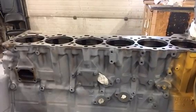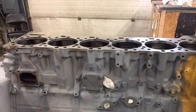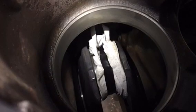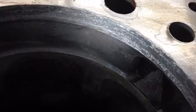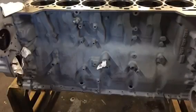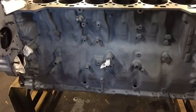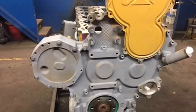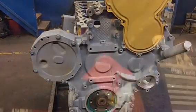This block has the crank in it with the front and rear structure on it. Got it back from the machine shop — it was hot tanked and I scaled all the nasty rust off it. I was trying to get it clean. These are where you drop the bores, where you drop the liners in. It had liner lower entry inserts installed because of the pitting. It was the first block I had sleeved and it was a lot tighter than a block that had not been sleeved — just something to think about.